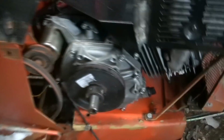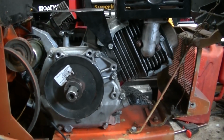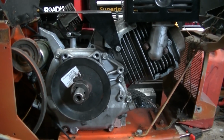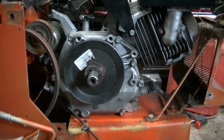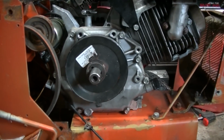And the problem comes down to the fact that these Honda engines and the clones that are styled after them have that cylinder leaning way down on what's like a 20-degree angle off horizontal, and that tends to make for a very long engine. It's not very tall, which is okay if overhead clearance is a problem. But front to back, yeah, that makes things a little bit difficult.